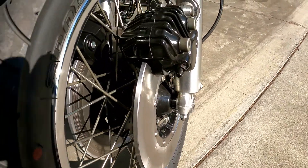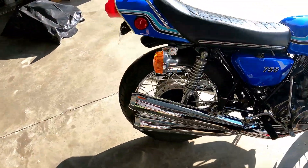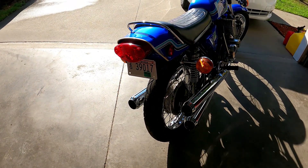On the left hand I used the OEM caliper, but I did put a new rotor on it. There's a little bit of scratching on there. On the rear, when I took the wheel off I basically just scuffed the rear pads — they were still in good shape so I didn't take them off and replace them.